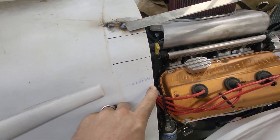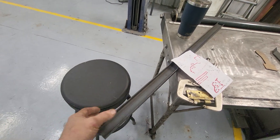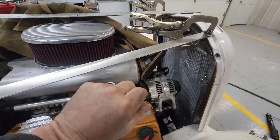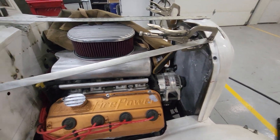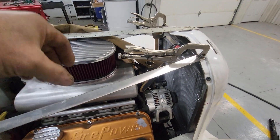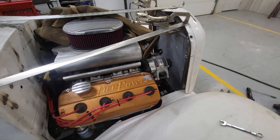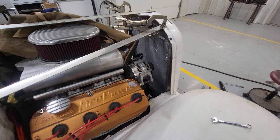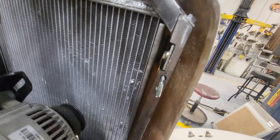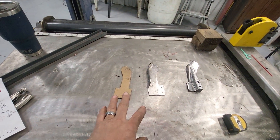This is one inch. The rail is c-channel just like the front, turned to the inside so the hood side will come up and be formed around and sit down onto that channel. Like I did on that '37 over there — I put two pins in the rail holes and then you just slide it down and that's what holds it all in. You can foam the back side so you don't scratch the paint. Now I've got a lot going on in here — bolts going in here, bolts going in here — so I'm coming into there.